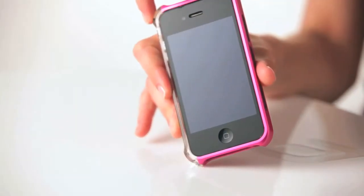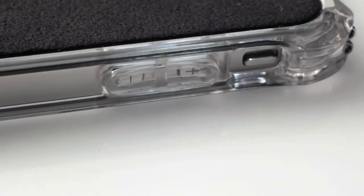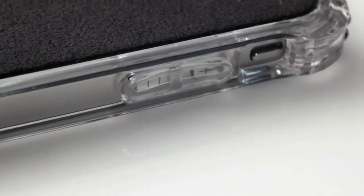Notice this side of the case — we've actually flipped the frame and cap positions from the original Vapor. We're also making the cap as an injection molded high-impact polycarbonate material that really minimizes the antenna loading problem, the death grip problem. The phone antenna was actually interacting with your fingers, and this design keeps them away from the most sensitive part of the phone.